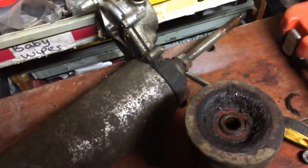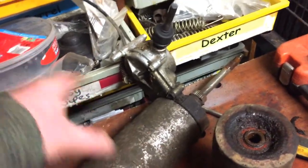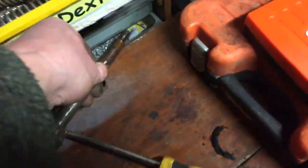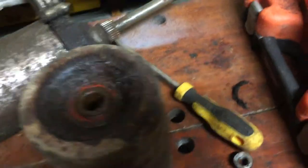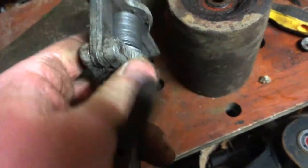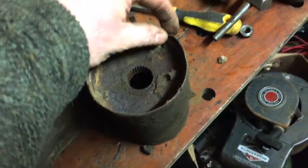They're quite easy to take off — there are only two bolts, and at the other end I disconnect the cable. The cable comes from the top of the handlebars and you have to take the cover off where the cable and the PTO bit comes out, then you just maneuver it out and it comes off quite quick. For the end bit where the keyway is, you really need something like a little puller, because you can see how rusted it was on there and it would have been a job to get off without that puller. Worth its weight in gold, that puller, when working on mowers.